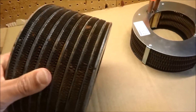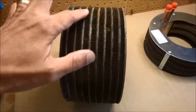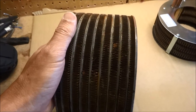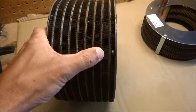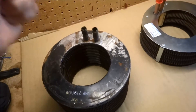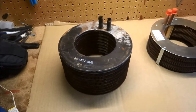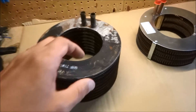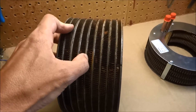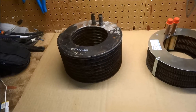This one leaked and as you can see the cores which carried the water actually ran this way, and when they get plugged there is no way that you can stick a wire or any kind of mechanism down there to clean that out. All you can do is attach a hose on one of these, force the water through there under high pressure and try to get that gunk out. The problem is a lot of water pressure on here will cause this core to get damaged and leak, so it's not really a good solution.